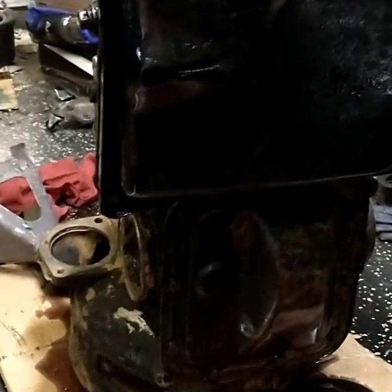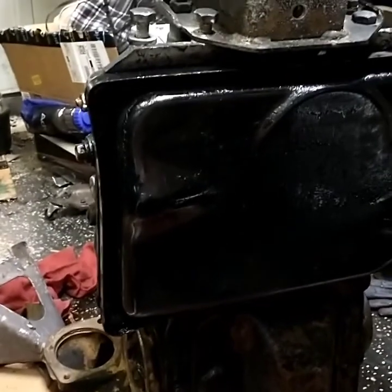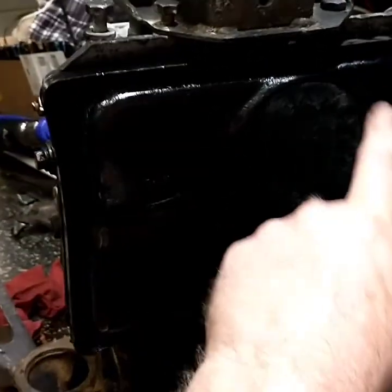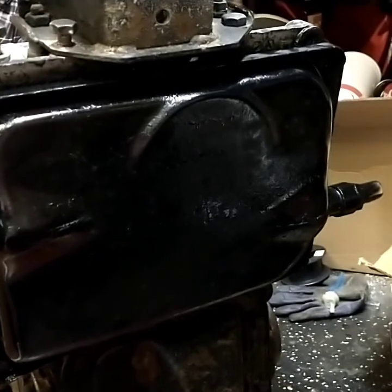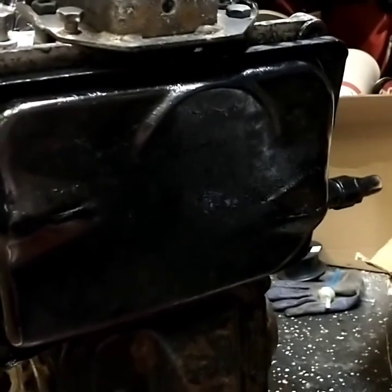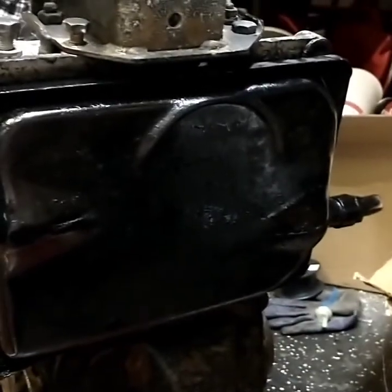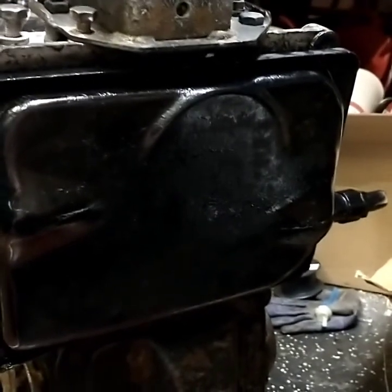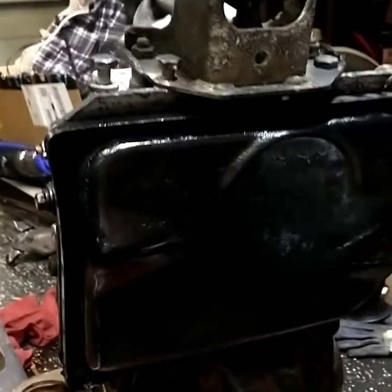Maybe next time I'll take actual video — I have some photos and we'll put those at the end. Torque specs: 14 foot-pounds for the bolts, 26 inch-pounds for the Phillips screws that hold the filter on, which is about two foot-pounds — so really light, in other words good and tight. Anyway, boys and girls, we'll see you later — don't forget to like and subscribe and hit the bell.